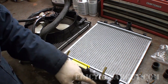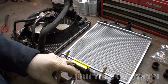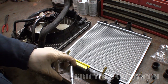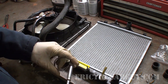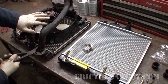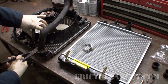It's down low where you'd have to remove a bunch of shielding and everything to get to it — it's just the kind of thing you don't want to deal with after doing a job like this. So you're better off replacing at the very least the lower hose clamp. If one of the upper ones goes, so what? It's right there, it's easy to get to.